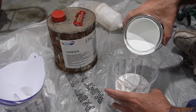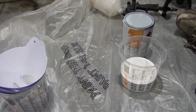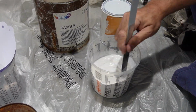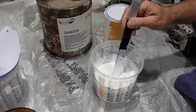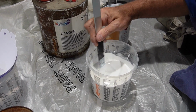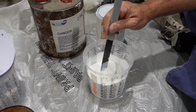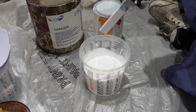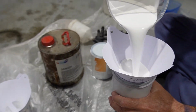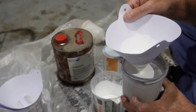So for the engine bay, a bit far and beyond, is a full strip, bit of a half-ass shave. I just spot welded all the holes up, metal putted here and there. I didn't go too crazy, but yeah, so stripped it back, took all the gunk and grime out of the paint, out of the engine bay, cleaned it, probably took me 2 days to clean properly, wet sand, and then prime. Put some more body filler in it to smooth some edges, and then wet sand it again, and then wet sand it again, and now we're going to lay down some paint.